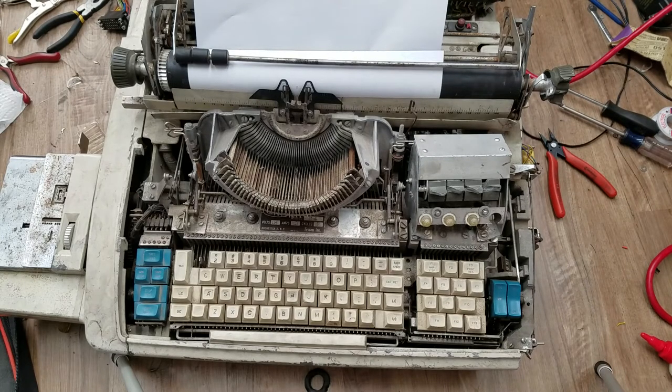I don't think it really matters - I'm not going to care too much about using this as a typewriter given its state. I have other mechanical typewriters like the IBM Model 01 which mostly works. At this point I'm mostly looking towards using the punch and the tape reader - just to play around with those and not really caring too much about the typewriter section. But like I said, it turns on and doesn't blow up, so we're getting somewhere. The only key that actually reached the page was the P key - all the other keys are somehow stopping before they get there.